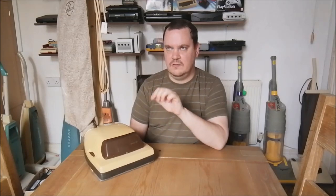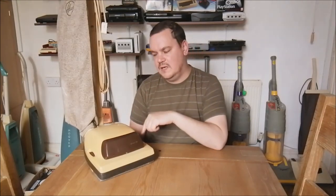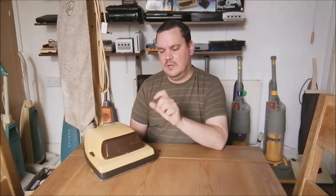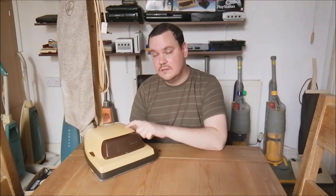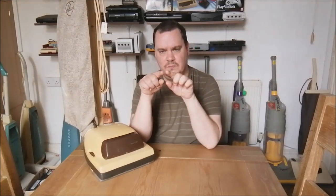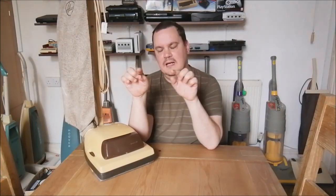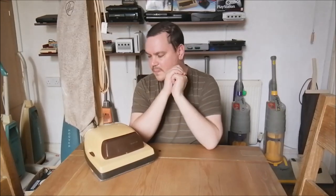They all had the barrel style previously, including the original 1036 Mark 1, but the 1036 Mark 2 did not have it. It had an Electrolux style. If you look through my videos, you'll see quite a good one to look at is the Electrolux 350, where I take the suppressor off the 350's motor. It's exactly the same style of suppressor that was in this. It just has a couple of little tags on it, and it goes across the terminal block. If you imagine the suppressor's there, it's got a couple of little tags that come out, and it just crosses the mains voltage.